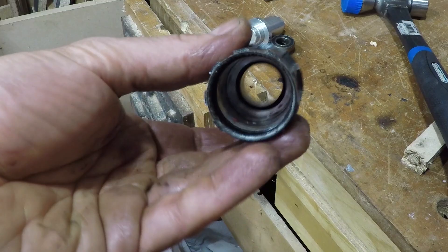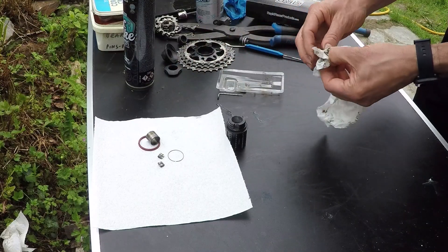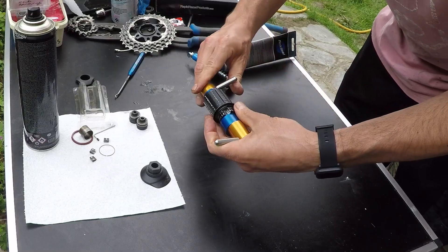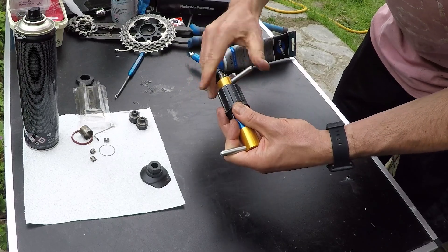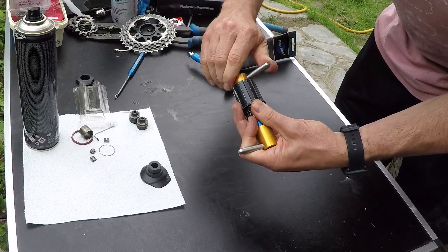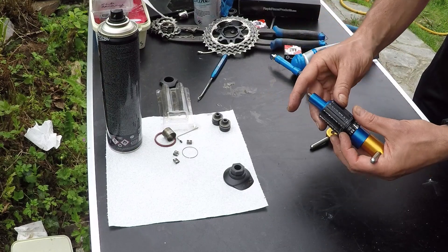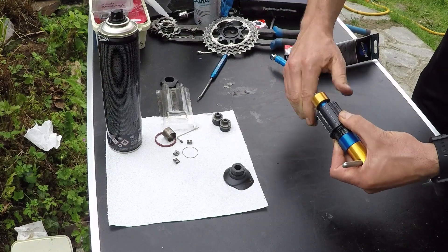Give the body and all the parts a good clean. I'm using two new Enduro 6902 bearings — you could upgrade to stainless steel or even ceramic bearings if you like. Grease the outside and inside of the bearings to help them slide in easier and ensure they don't seize in the free hub body or on the axle. I'm using Park HPG1 grease for everything. I'm using a bearing press and extraction tool from RRP, linked below, that I bought for linkage bearings on my mountain bike — it's excellent for hub bearings too, but you could also use a punch. If you are using this tool you'll need their number 11 kit for the 6902 bearings.